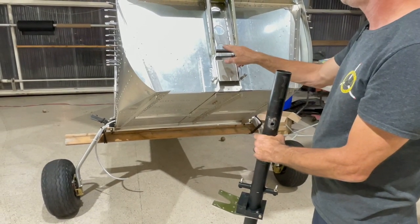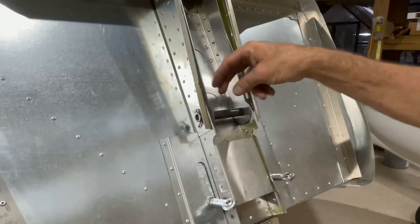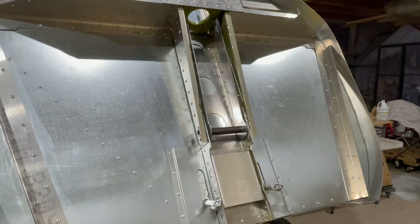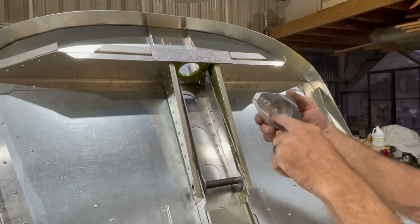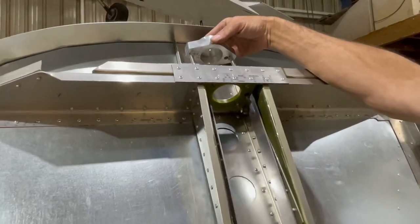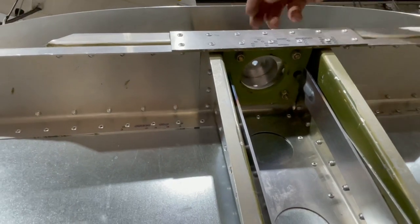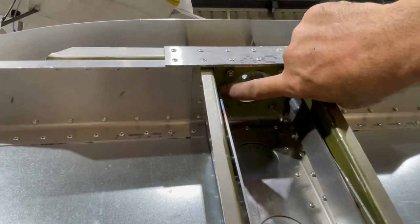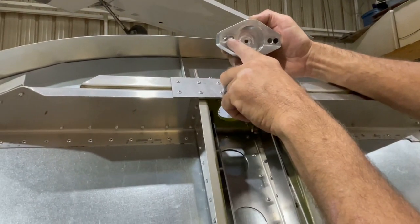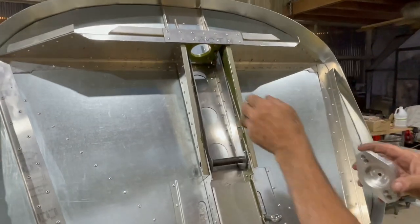We installed this heavy-duty 5H tube and drilled for a cotter pin on both sides, which locks that in, and we installed these straps at the same time. We also got our top saddle. Prior to installing all this, we put a hole saw or anything round in here and wound some tape on it because this diameter is smaller than this diameter — we needed something to center that on the hole so we could drill through here and here. We started with the 5/16 hole as a guide, the outer ones for the 750 and Super Duty, and the inner ones for the 701. Once we had holes, we removed that and brought the holes up to 3/8 just to have a little room for these to float a tad.